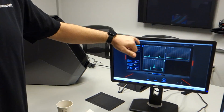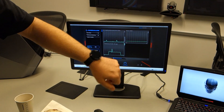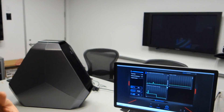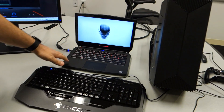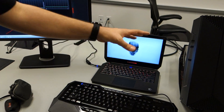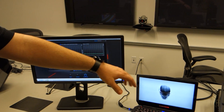If you look at the real-time performance monitor, you'll notice we're running a Core i5-4210 CPU with 16 gigs of RAM and a GeForce GTX 980 GPU. Is it possible to use the mobile graphics card as a physics processor? Unfortunately we can't do that right now, because we literally have to disable it to push out to the external card. What is cool is that the notebook is still running on the Intel integrated graphics chip alongside the GTX 980. Anything directly connected to the notebook runs on Intel, and when you hook up to an external display it'll run off the 980 — or if you don't have an external display, the 980 will push back to the LCD panel itself.